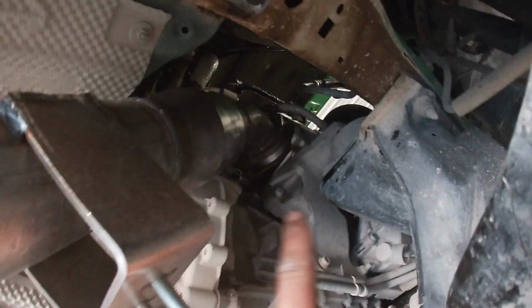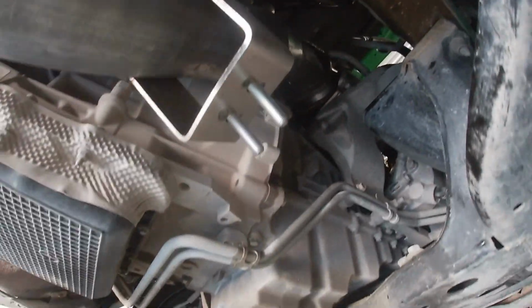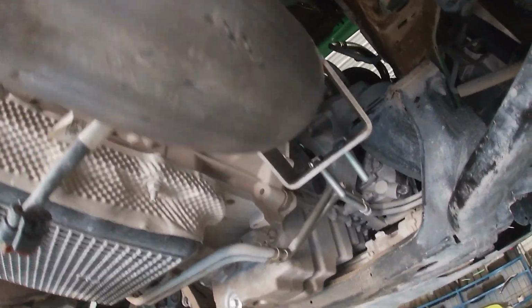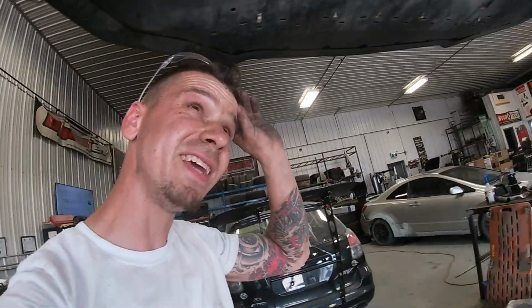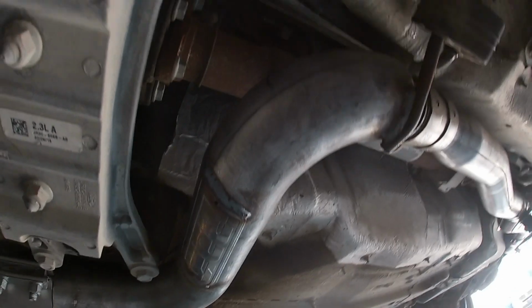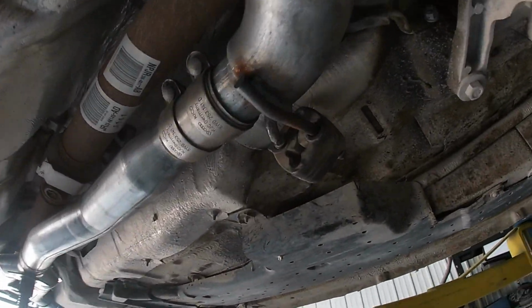Oh, up at the flange, the nuts are just loose. Throw our bracket on, assemble the rest. Just like the top side, we can put our clamps in place. I wouldn't tighten anything fully up till we get our tips on there and we can fully align this whole thing. It's hot out there. Check it out. That's a pretty easy exhaust to put up, guys.